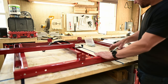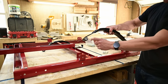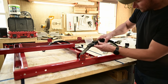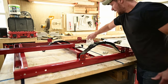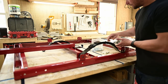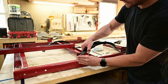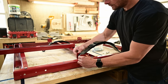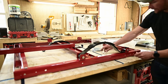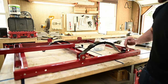I've got everything tightened up. Now it says to add the springs. There's no hole back here — this hole right here faces forward on the trailer. Out of the spring and axle hardware bag, we're going to use two of the larger bolts that go through like that. It says to leave this loose for now, so we'll tighten it in a minute.